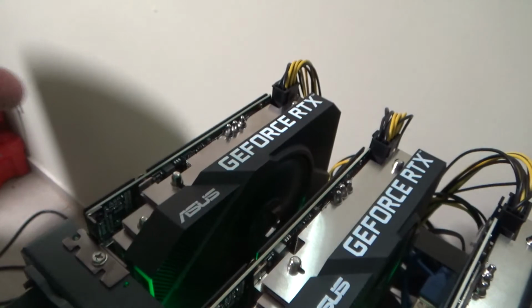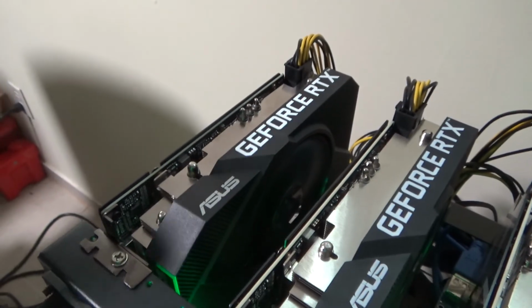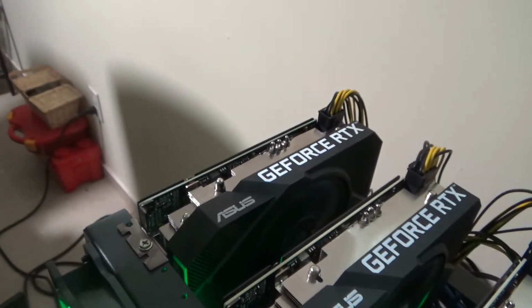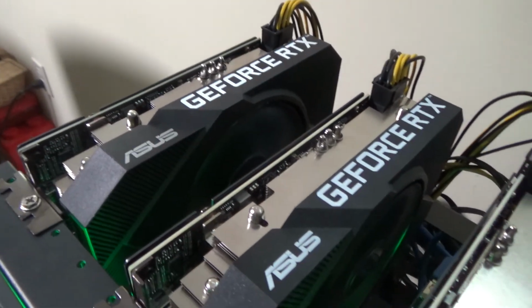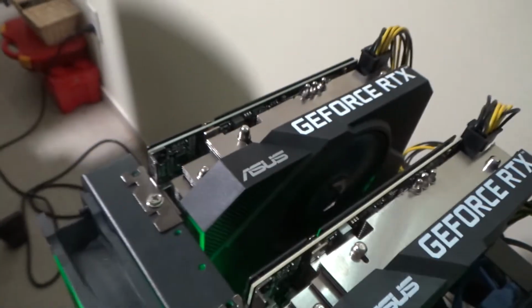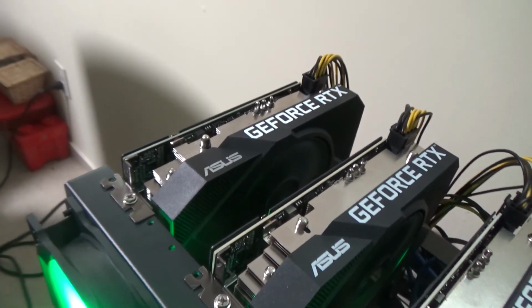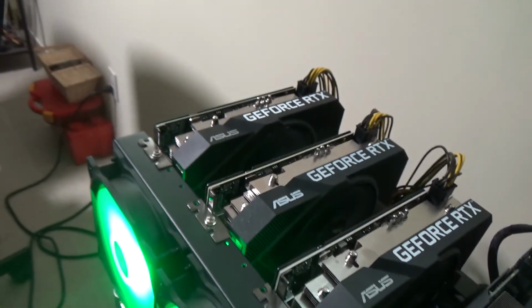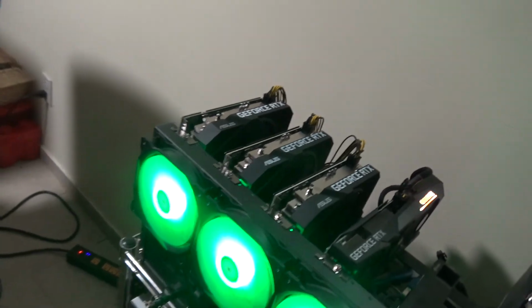I turned it off a couple of times and messed around with it. It would spin a little and then it would kind of get stuck, but I pretty much cleaned it out, and I put a little bit of this lithium grease right in the middle where the bearing is, and it seems like it's running perfectly. It does make a little noise if the bearing is bad. I can hear a little bit of a dragging noise, and I still think that it's going to fail. So I'm just gonna have to order another one of the right fan. But for now, this was pretty much half fail, I would say. But it's working.